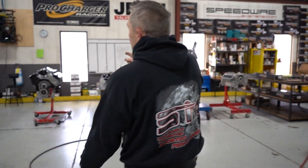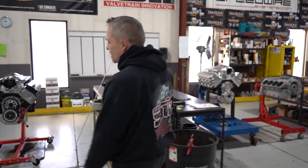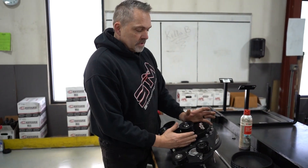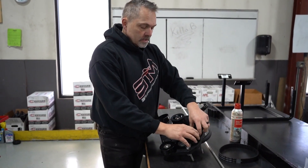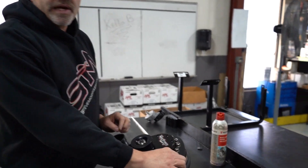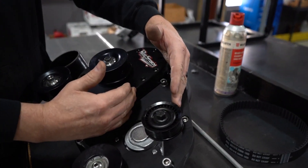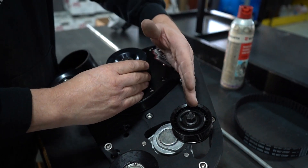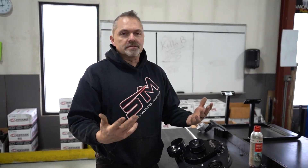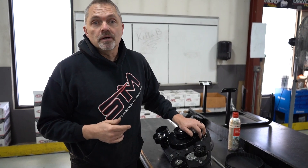Other stuff that I saw was good comments. What I was also thinking would be a pretty good possibility is building a strain gauge into the supercharger mount. The supercharger would have to pivot, or be allowed to pivot, onto a strain gauge, and you'd measure how much torque it was inserting onto the supercharger. That would be a good method too. We'd just have to figure out the math of the distance of the strain gauge — it's not as simple as you just put a strain gauge there and measure it. You'd have to figure out the math of how that would all correlate.